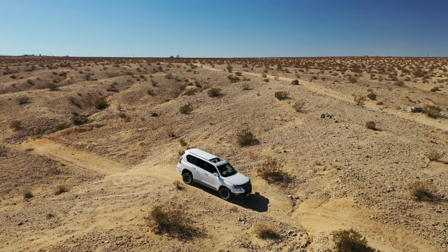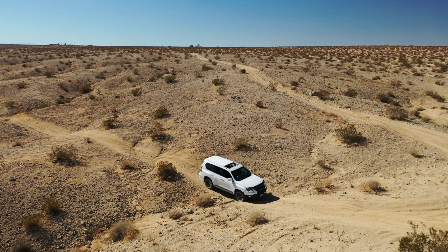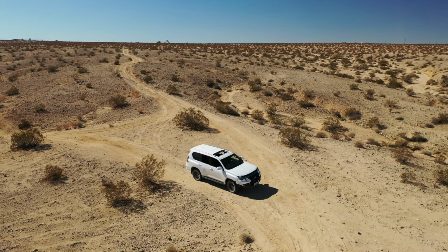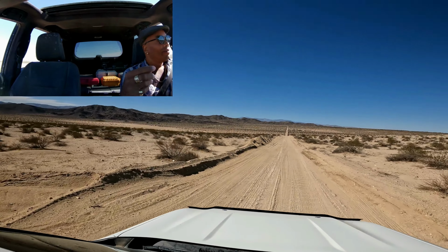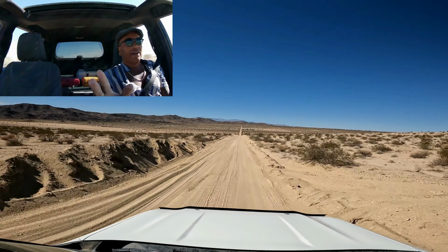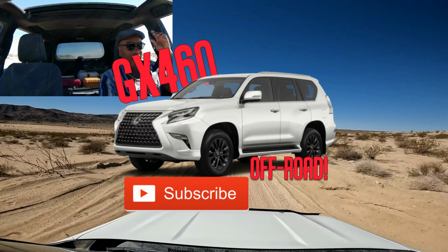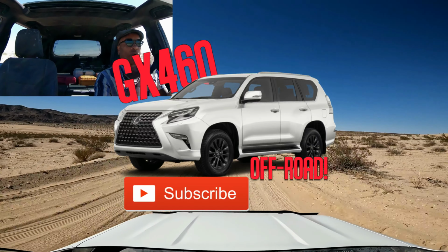And always remember to do this before you run into obstacles and not after you run into obstacles. The last thing you want to do is be not prepared for where you're going. In other words, the best off-road advice I've ever been given was to be configured before you get into trouble and not after you get in trouble. So that's why I'm a proponent of locking the center diff, putting on all your traction aids. Whatever car you're driving, be in the best configuration possible before you get into trouble.